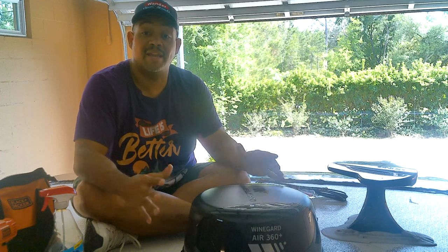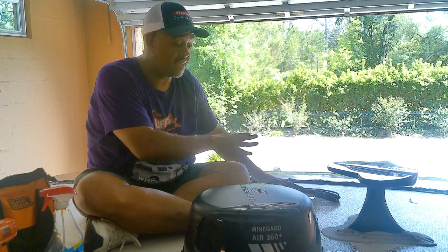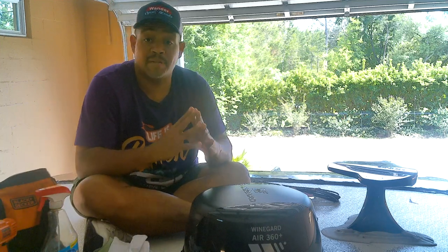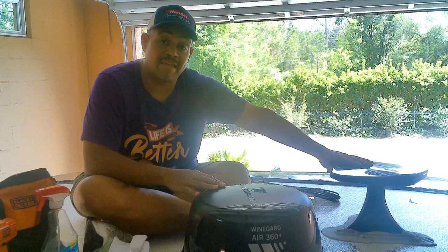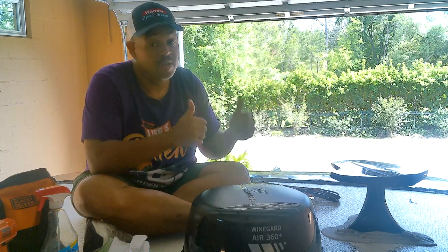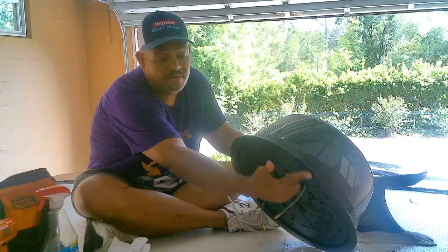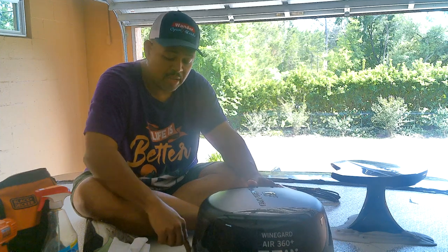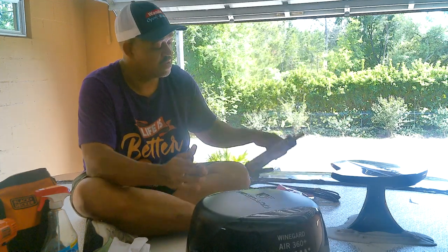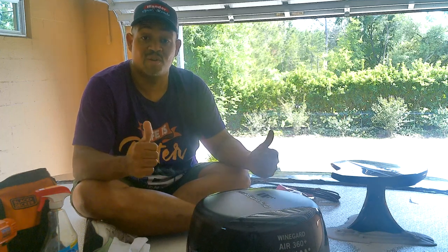Now we are up on top of the rig. I've brought my dome, all the cords and things that came with it, my tool bag, some Windex and rags — because once I take this old antenna off, I have to make sure the roof surface is nice and clean so the new product will adhere properly. Very important. I have some butyl sealing tape to use along the bottom edge of the new dome. I'm going to press that down tight, screw it down using the holes in the flange, and then use Dicor lap sealant to get a nice thick bead of caulk all around it so we don't have any water issues.